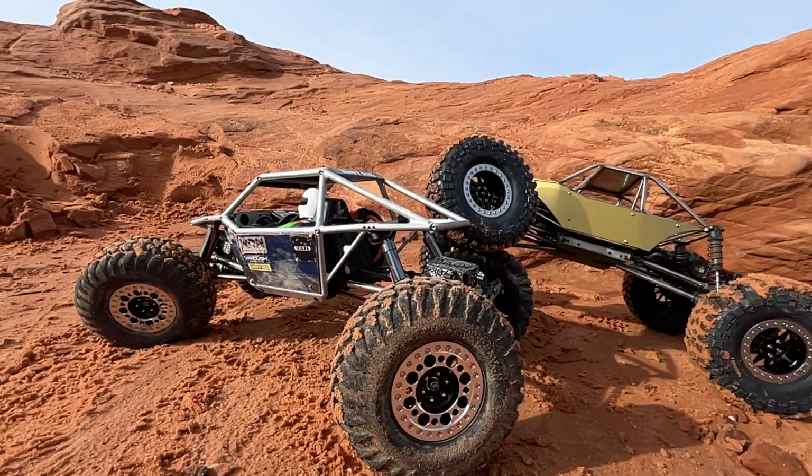The second issue was purely related to my budget preferences in electronics, shall we say. The Hobbywing 1080 isn't exactly the most impressive ESC that you can put in a rig, and it turns out that when you add between 100 to 150 grams of additional tube chassis on top of an already overloaded ESC that's running two crappy steering servos that are both overvolting, probably because they're under torqued, what you get is brownouts. Surprisingly, the Hobbywing 1080 never gave me a full power failure, but it did seem to reach LiPo cutoff much sooner, so that suggested to me that it was just draining the batteries way too much. Those steering servos didn't have enough torque to get the job done without just browning out the entire system.